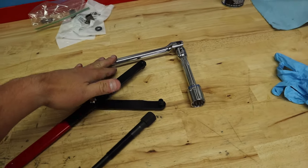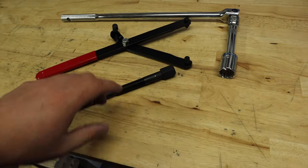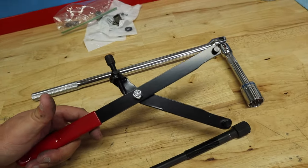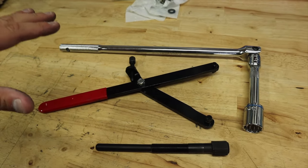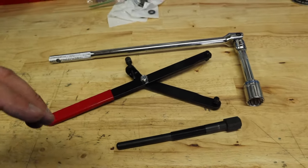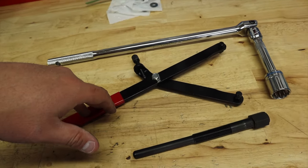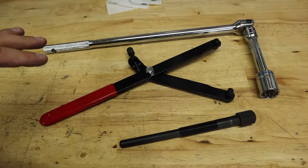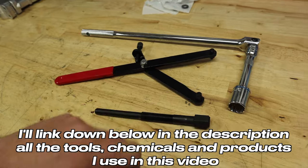What you're going to need to remove your clutch is first off a 21 millimeter 12-point socket — that is the head size of the bolt that runs through the clutch — and a clutch puller also. I'll link it down below where you can pick it up. And then this is a flywheel holding tool, specifically a Tusk brand. This works great for what we're doing today. If you don't use this, you can order the actual Skidoo clutch holding tool, or another brand like SLP or whatever. They're kind of expensive though. This one is fairly inexpensive, so I'll put a link down below where you can get it also.